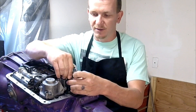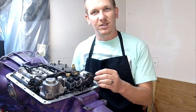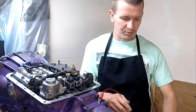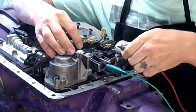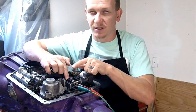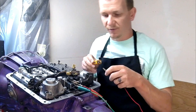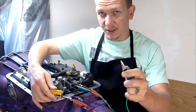I'm going to electronically disconnect them from the wiring harness. We're going to do a clicking test to see if 9V opens it — that'll be the first test. You'll need a 9-volt battery and some test leads. We'll use red and green — doesn't matter which side. You might have to probe yours from the harness side if yours doesn't have prongs, but for the video we'll do the easy route.